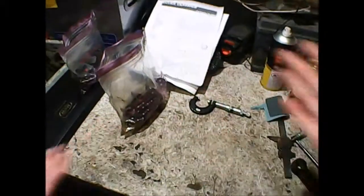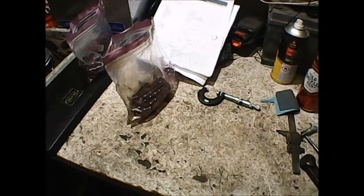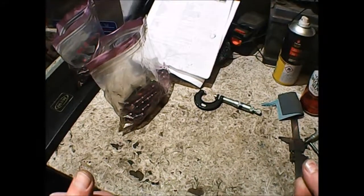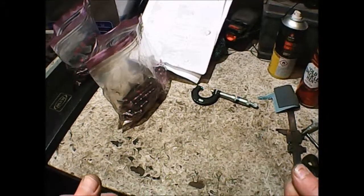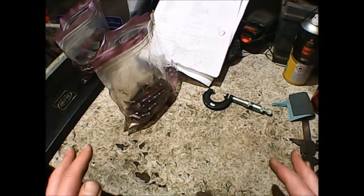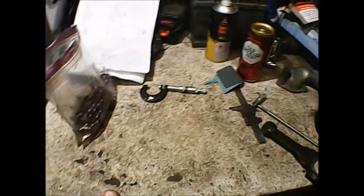The initial diagnosis of the engine was that the bottom end was filled with gear oil. However, there was no oil whatsoever in the oil pump. So what's happened is someone's run the oil pump dry for one reason or another — maybe they changed the rotors or something — but they hadn't primed the oil pump. They started the engine up, and there's no way a Rover V8 is going to prime its oil pump by itself. It needs help — it needs Vaseline packing or some way of winding the oil pressure up.